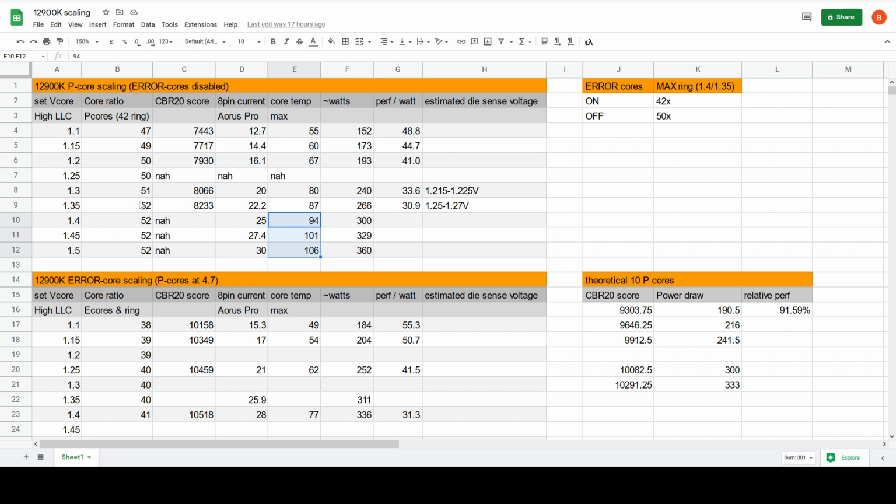So yeah, with 12th gen, I'd say the limiting factor is just going to be your cooling, which is why I also said liquid metal might be an interesting thing to consider using on these CPUs. Also, just get the biggest cooler you can. Honestly, I'd say custom loop. This is one of those CPUs where I think I'd go for a custom loop. I'd have a 360 millimeter radiator dedicated just to the CPU alone. And then I'd very much probably go with liquid metal between the IHS and the CPU itself. Well, I mean IHS and the water block. So not going all the way with a D-lid.